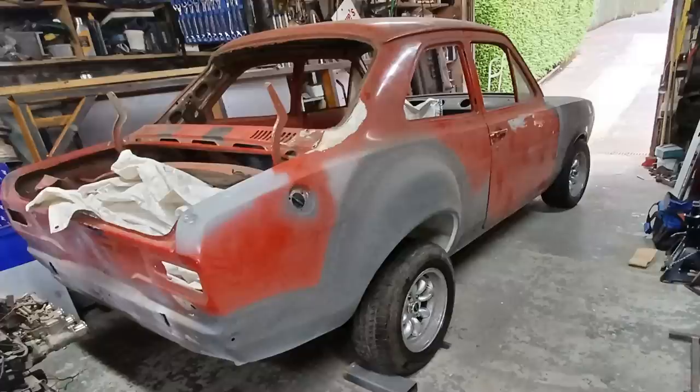But now she's on her wheels and there's some weight in the car, I can start putting the front arches on and I've got the bubbles ready for the arches as well. So that'll be the next video, putting the bubbles in the arches on the front and getting the wings to line up with the doors and that, because it makes a big difference having the car on its wheels to get the panels lining up nicely than it does having the car on a jig, because as much as you don't want them to, they do move slightly, and that slight movement can make a big difference to the panel gaps. So that'll be the next one.